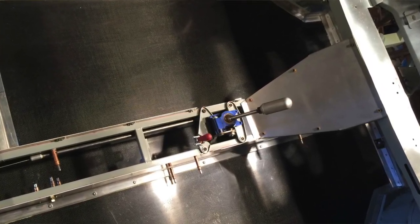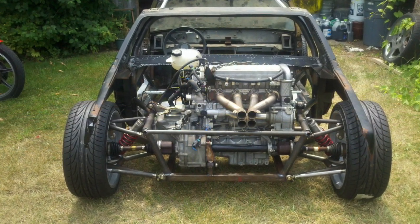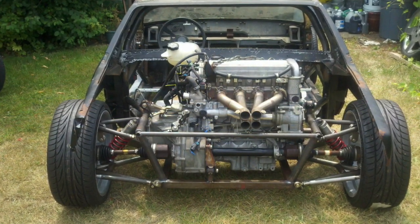There is a roll cage inside the B-pillar above your head, kind of hidden, which goes down into the frame and into the bottom frame rails. He put the car up on a rotisserie to install the floor, which is a carbon fiber honeycomb aluminum floor riveted on — all completely custom. He's done almost all of it himself. I've helped a little bit with the floor and other parts where he can't move the bigger pieces easily. He's also made custom exhaust for it.